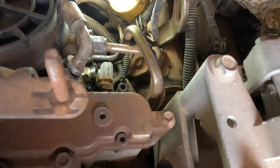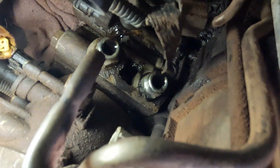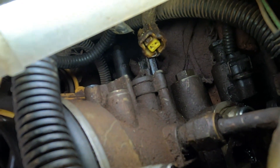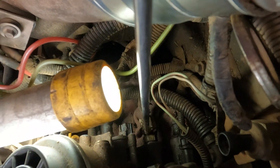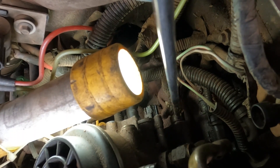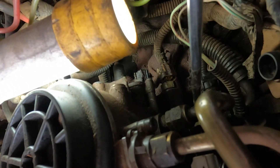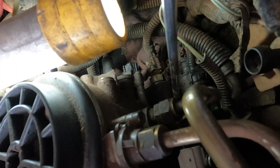I can show you these now that it's all lit up down there better. You can see the two holes - one, two down there at the bottom. Now we need to take loose that back bolt. I'll drain the oil pump out so we can get all the oil out of this high pressure pump. I've got it almost all the way out. We're going to drain this pump of oil so I can take these fittings out and make sure they're nice and dry and clean before we add the special thread sealer and re-O-ring our fittings.